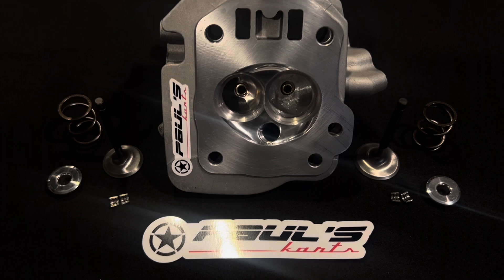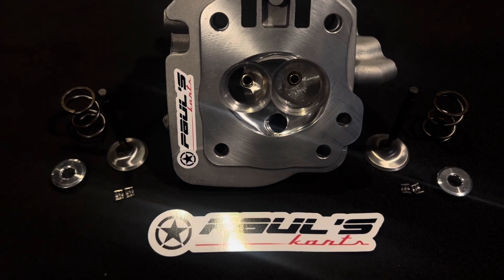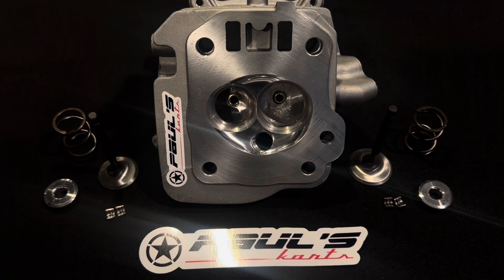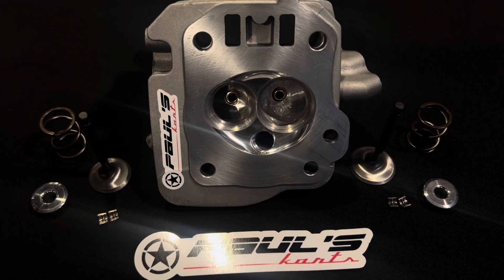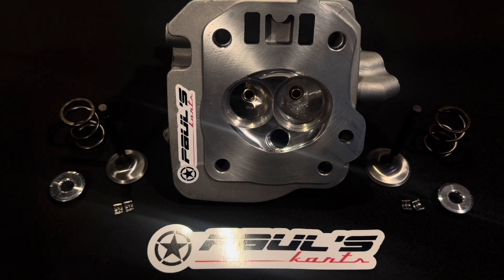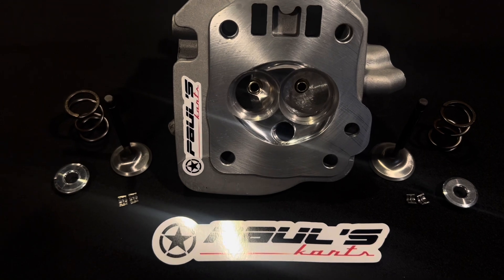There is no need for anything extra. This head is the best head you can possibly get for any engine because it's built by the math. It's so important to build things correctly and know how and why you're building them. If you have too little CFM you can't fill the cylinder; if you have too much CFM you're sacrificing velocity, torque drops off, and you end up with an engine that just won't perform.